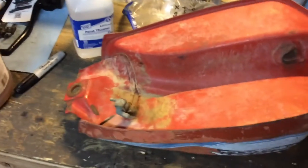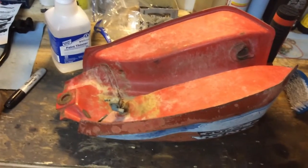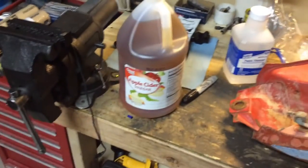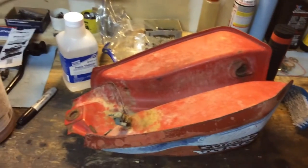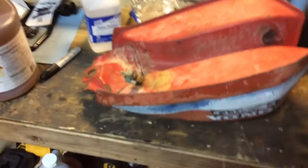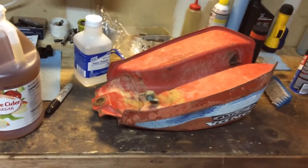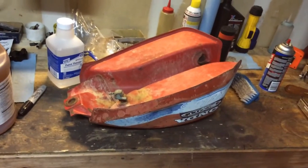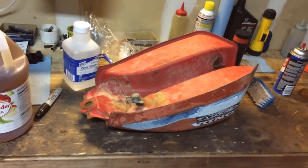You don't really have to shake it unless you don't fill it all the way. The very first one I did was a 250SX, and I shook it a few times whenever I was thinking about it — commercial comes on, walk out to the garage real quick, shake it up a few times. That one I only did for about 24 hours. The process I use — 36 to 48 hours usually turns out pretty good. So I'll dump the apple cider vinegar in, get it all nice and full, finish it off with some paint thinner, top it right off, and then let it sit for 24 to 48 hours at least. Then I'll hit it with the pressure washer — as long as no one knew you had paint thinner in there, I don't see a problem with just going to a local car wash and using their pressure washer.